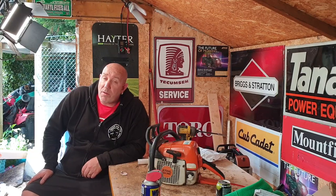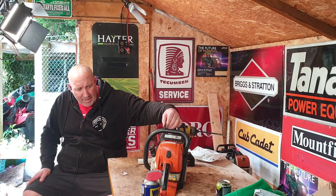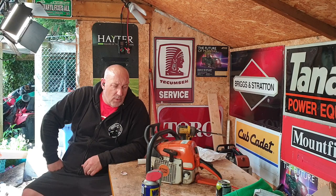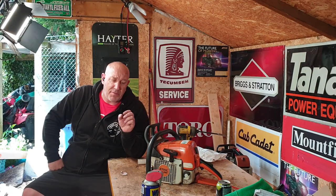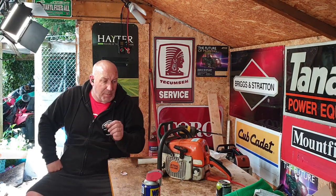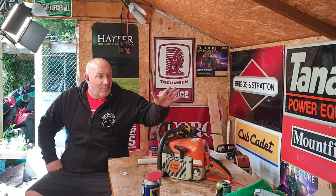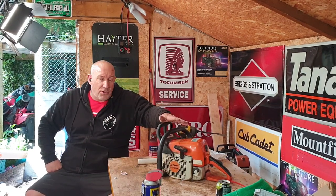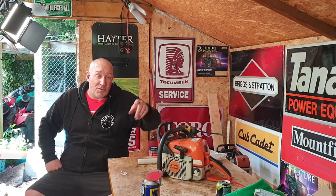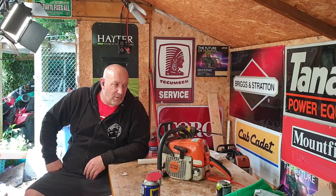Hello, I'm Mixed Murs and Merman and welcome to my channel. In today's video, my mate Craig has just dropped off a MS390 chainsaw. He said the sprocket is worn and also there's some little tiny bits of metal that came out from under the guard here, and he showed me one and they're the roller bearings. So the roller bearings have collapsed. I've got to put a new clutch drum in there, sprocket and new roller bearings. I have to remove the clutch as well, just to clean behind it and make sure there's no roller bearings in there.